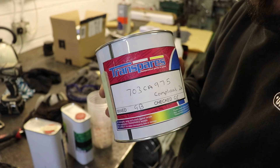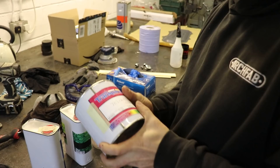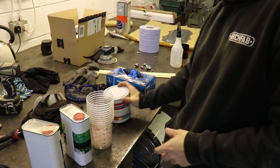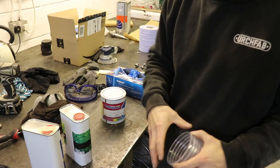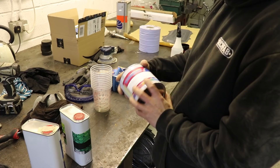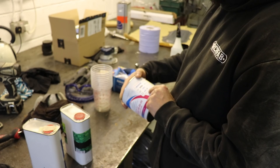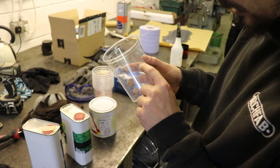So I need to mix some paint up. I've got my paint. This is a compliant 2K paint — I don't really know the ins and outs, but basically it just doesn't have some of the really toxic stuff in it that the non-compliant one does. And because this car is like half a modern car and half an old car, this is what needs to be used. I'd rather use something that's less toxic anyway. So two parts paint, one part hardener, add up to 10% thinners. This scale on here is two to one and it gives you the percentage for the thinners, so that makes life easy.